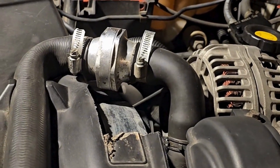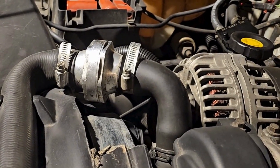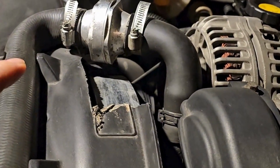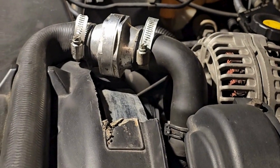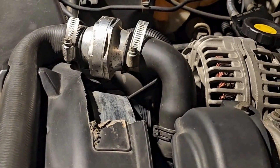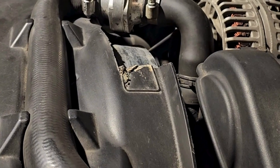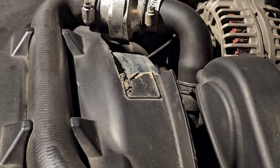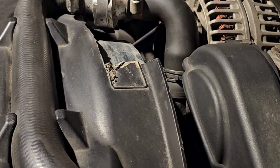And it's not perfect. This is not as big of a deal because it's a drilled inner thermostat inside this thermostat housing, which allows the air to travel through the system and makes bleeding a lot easier. But if you didn't have that, you would need a bleed screw. So think about a bleed screw — if I were to do it again, I'd definitely be doing that.